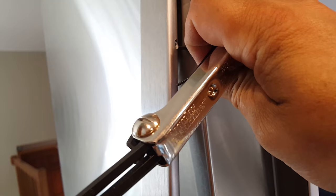Totally irrelevant, but what you're gonna do is put that tool in there, and just like a screw you're gonna tighten it up, being careful not to scratch your appliance by having the other parts of the tool touch your refrigerator. So you're gonna turn it like a screw — I'm doing this one-handed, so if I can do it one-handed you can certainly do it two-handed. It may take a while because these things loosen over time, and you can tell it's the right size because you're gonna feel the tension and see that mechanism actually turn inside of there.